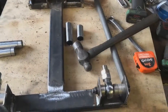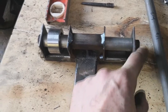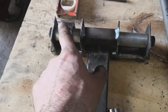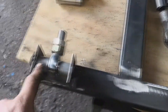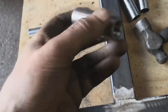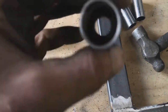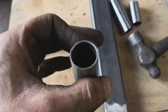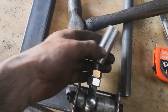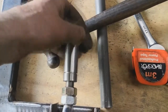As you can see everything is kind of in the jig with the spacer. When I do the arm for the other hand, the spacing goes on the opposite side for the opposite hand. I've machined out a couple of bosses so they fit inside the tube. This is really thin wall tube — 60 thou or 1.5mm — which I'm hoping is going to be up to the job. I've decided to do it this way with the tubes.